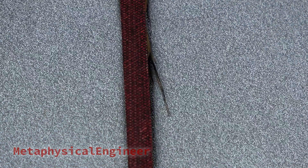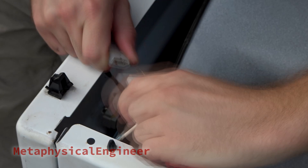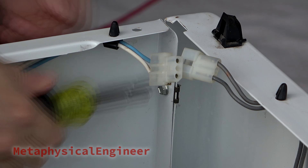There's some wear and tear on this belt — it hasn't failed, but is coming due for replacement. Next, the front panel has to come off. The door switch lives down there, so have to undo that connector first. Two 5/16ths screws hold the front panel on, one in each upper corner.